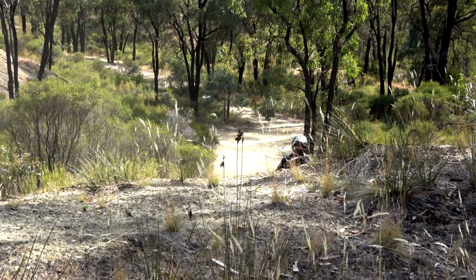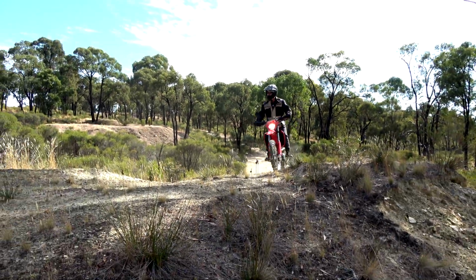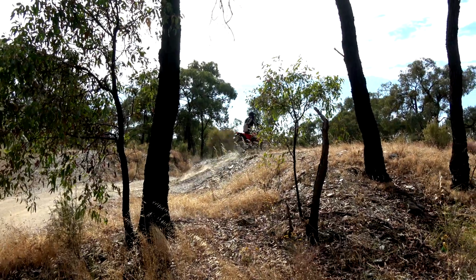So doing the inclines at slow speeds, you're having to feather. Normally, even on the big bike, because I've geared that the way I like it, going up a steep incline, I'm not clutching it at all. If I'm getting myself into trouble, that's when I use the clutch. Whereas with this thing, the way it's geared at the moment, it's all clutch. Low speed going up a hill, all clutch. So just too tall, for doing the stuff I like to do. So I think the front sprocket will solve that problem.